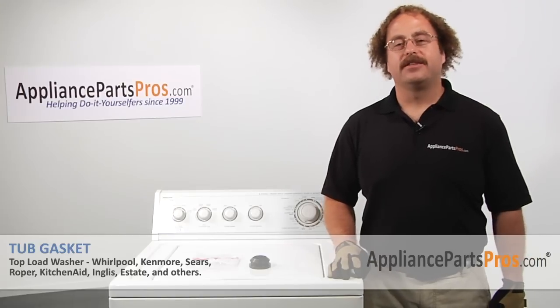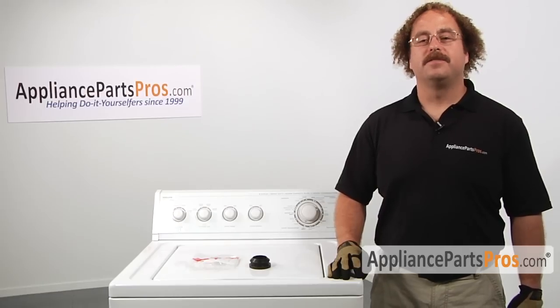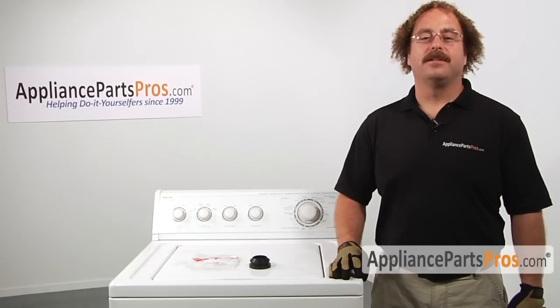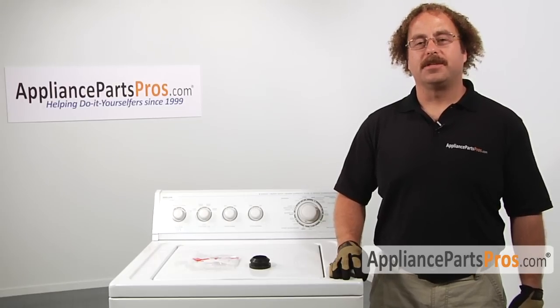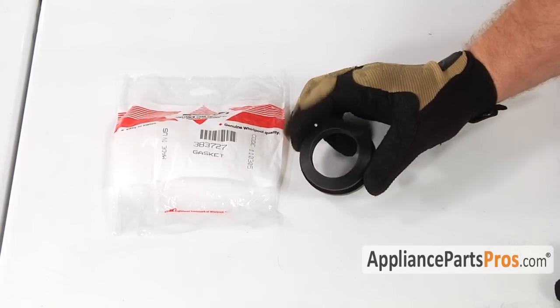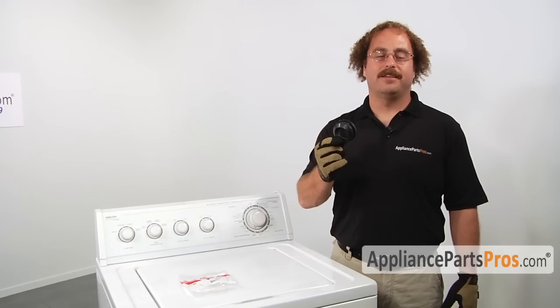In this video we're going to show you how to change out the center tub gasket. It's going to be a very easy repair and should only take us a few minutes to show you how to do it. If you already have one of these, great. If not, you can click on the link below or get it from AppliancePartsPros.com. When you open up the bag, you're going to find the new gasket inside. The main reason you'd be changing out the tub seal is if it sprung a leak and you're getting water coming out of it.